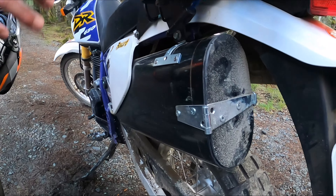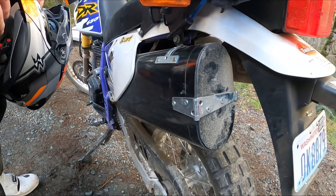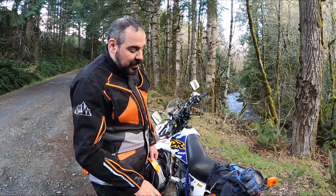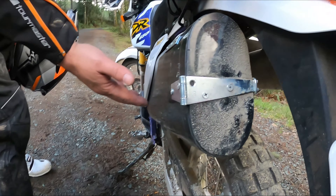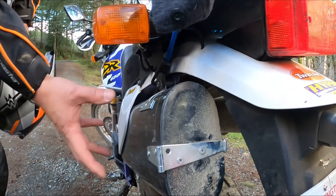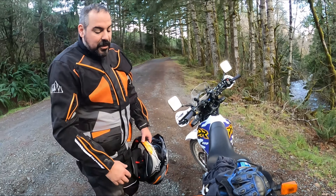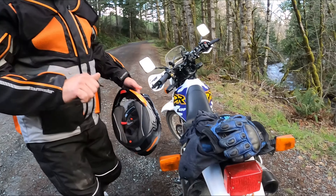The normal thing is it comes with a really tiny toolbox which is pathetic. The upgrade everybody does is a four-inch tube about 16 inches long. I saw that and thought there's a lot of dead space under here not being used, so I basically took a 12-inch sewer pipe, 24 inches long, heated it up, got it nice and soft at about 230 degrees or so.